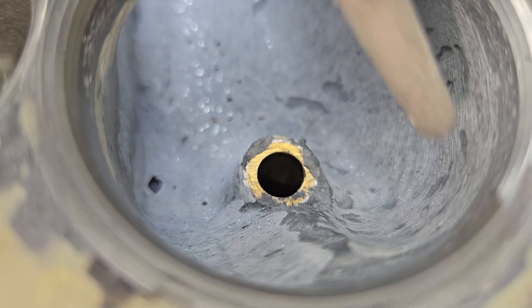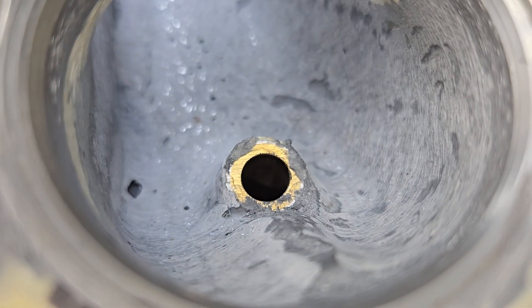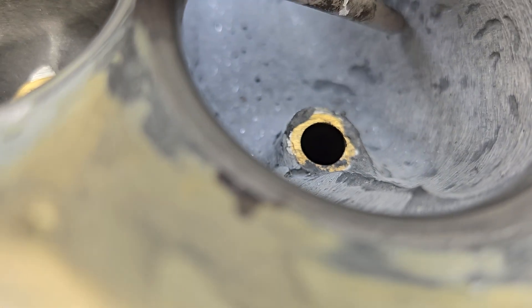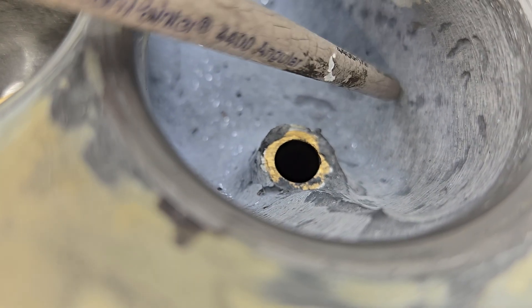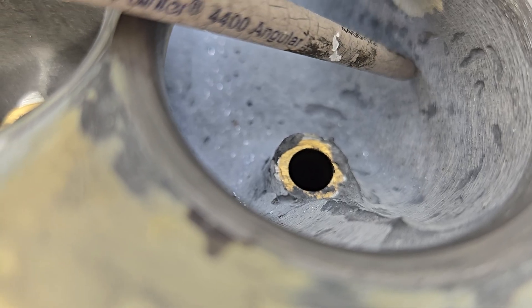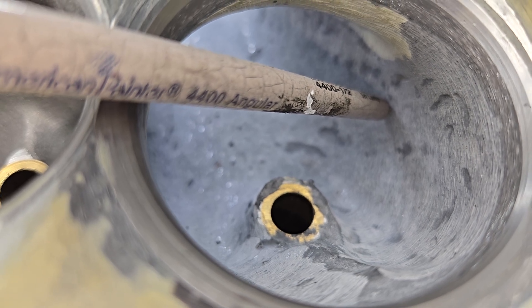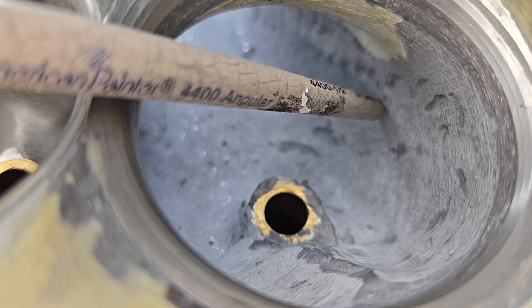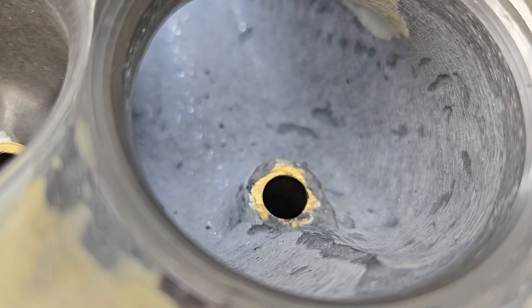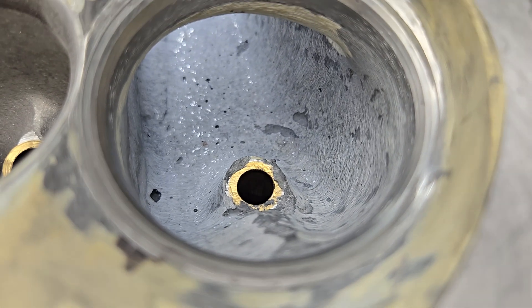The part that I did fill in — I put a lot of fill in this area because this part of the bowl was quite bad. As far as air speeds, this picked up nicely. This one's still pretty dead, and if I put my pitot right around here it still has an airspeed of zero. In the comments you can let us know what that airspeed of zero means on a port that's flowing 340 plus.